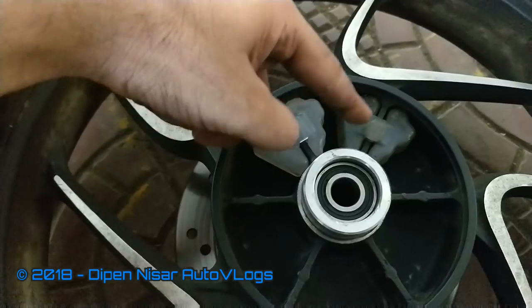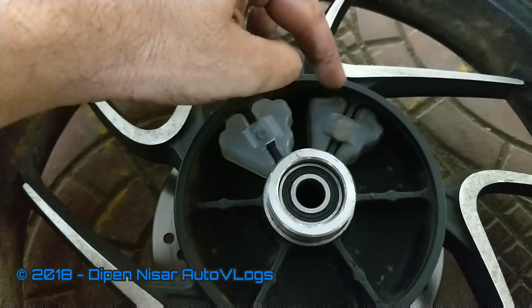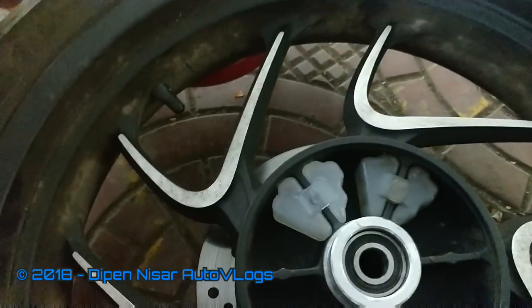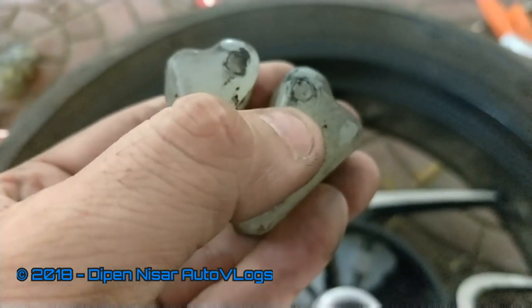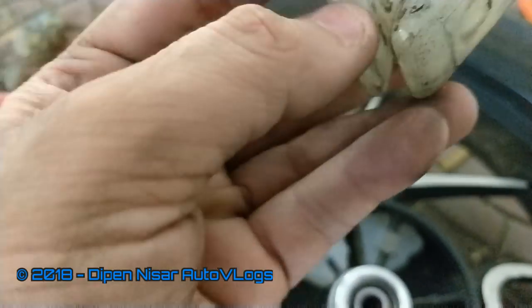The play comes in because of high speed riding — the hub gets hot, the rubber gets hot, and the rubber wears out. If you look at the parts inside, you can see they are brushed at these contact points, showing the wear that has occurred.